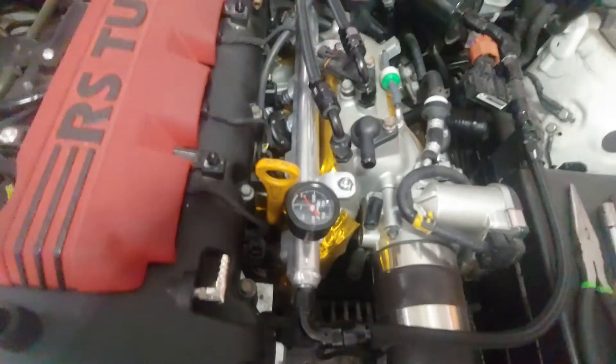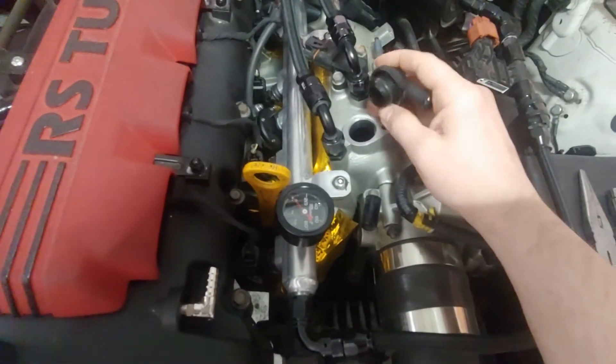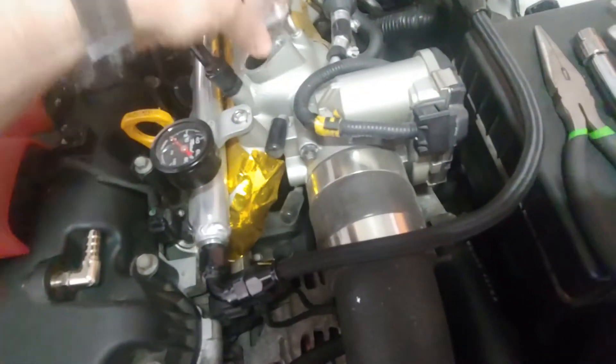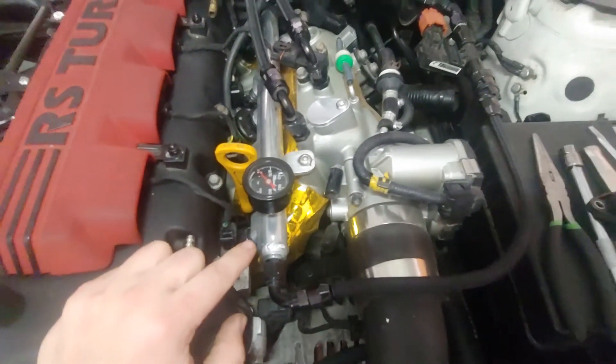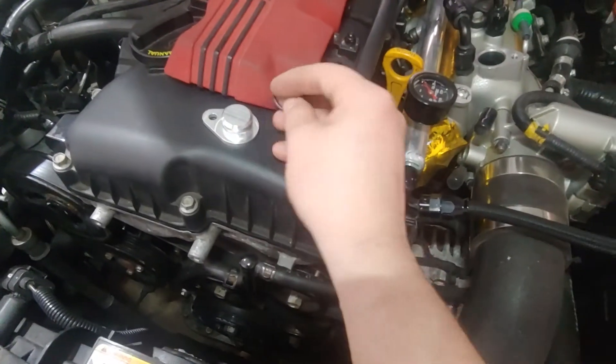There's a 10 mil up here, and then this plastic piece is what we're going to be removing. There's an o-ring on here that will have to get removed and transferred over — I've actually made a custom billet piece and I'll show you what it looks like. Essentially that billet piece is just going to get bolted down and then we'll have the hose running this way around to the intake, so we don't have any vapors or oil getting recirculated back into the intake.